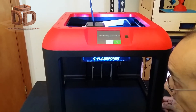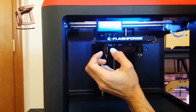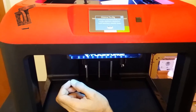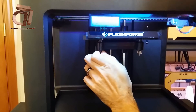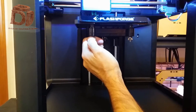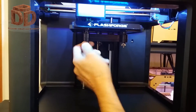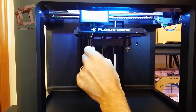The extruder is moving over and touching off to verify the distance. It says: unscrew the corresponding nut under the platform clockwise until hearing a steady beep. This is the corresponding nut — the one underneath where it's working right now. I'm going to begin turning clockwise slowly. The platform is raising as I'm turning it clockwise.